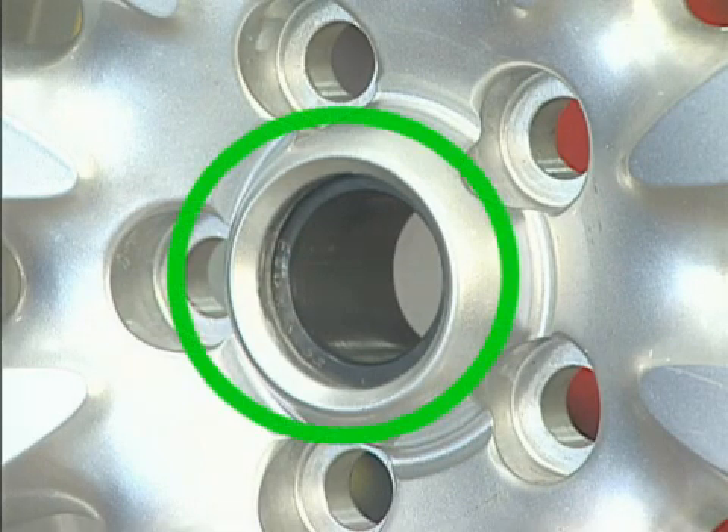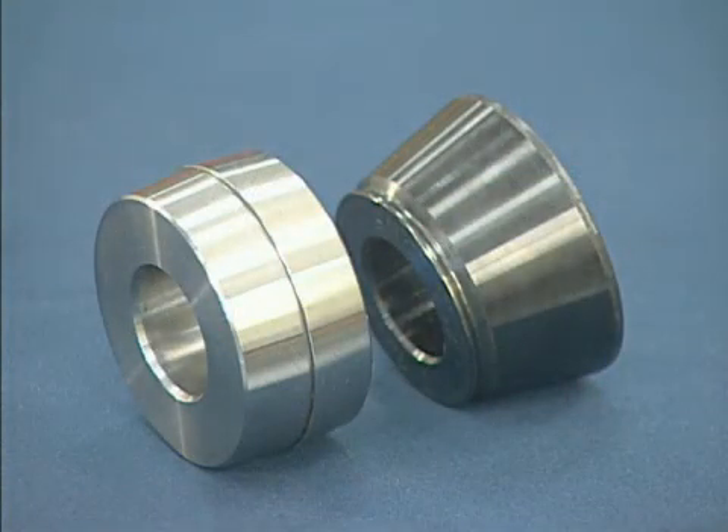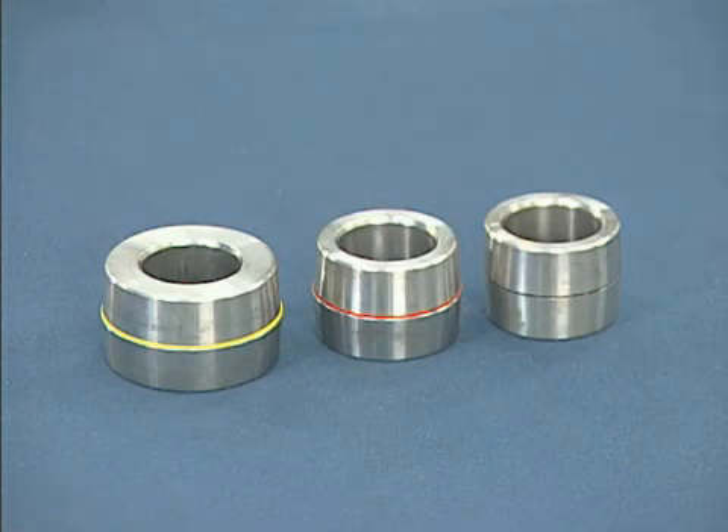Typically, these wheels have a smaller diameter hub-cap bore on the outside. And because of their steep taper, standard cones have a difficult time pushing the wheels centered. With a double-ended direct-fit collet, each of these problems have been addressed and resolved.